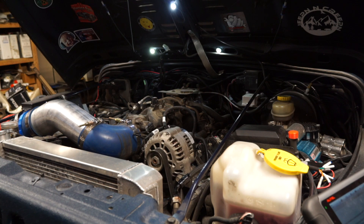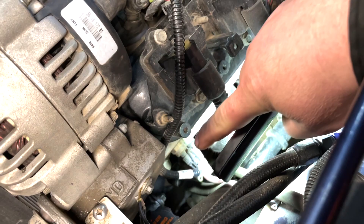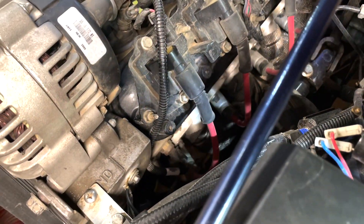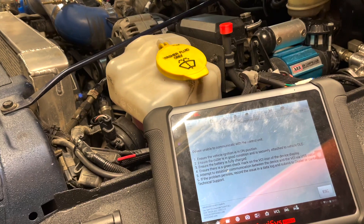What we're going to look at today is a P0117 — engine coolant temperature sensor circuit low voltage. On the LS Vortec motor, the temperature sensor is in the front of the driver's side head. It has five volts coming in and a ground — that's all there is. Whether it's hot or cold, it's going to be different resistance, and that's how it calculates the temperature.